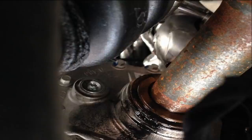So starting out for normal vehicle axle maintenance, yes, Ford has put out that rear axles or power takeoff units containing synthetic fluid, and light-duty trucks equipped with Ford-designed axles, are lubricated for life. Yes, have we ever heard that before? Okay, yeah, lubricated for life, with the exception. Here's the exceptions. You're not supposed to check them or change them unless a leak is suspected. Well, that stands for a reason. If you got a leak, you probably want to check it because it's probably low, right?